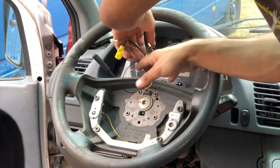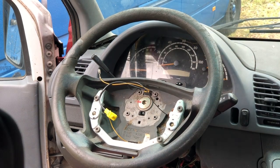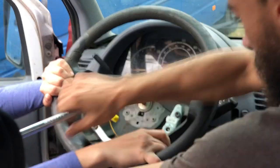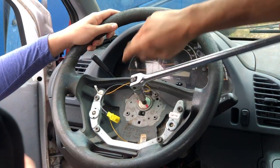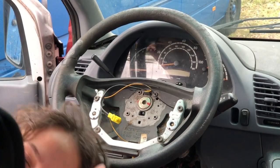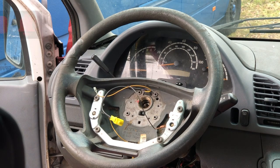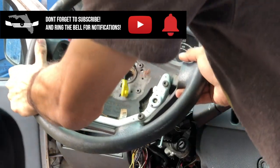At this point it's time to remove the wheel. I'm going to get somebody to hold the steering wheel — once you've had your significant other help, remove the H10 bolt. There's lots of thread locker still on it. Now all of these wires are going to have to come out, and then the wheel should just gently lift off.